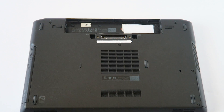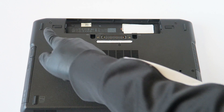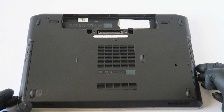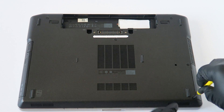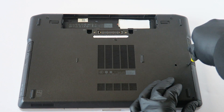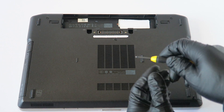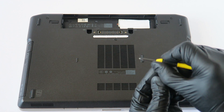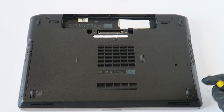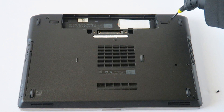There will be a total of five screws you have to remove. I'm going to start off at the bottom — you'll need a mini Phillips screwdriver, a really small one. I'm going to remove the two screws here from the hard drive area, which has a plastic cover.